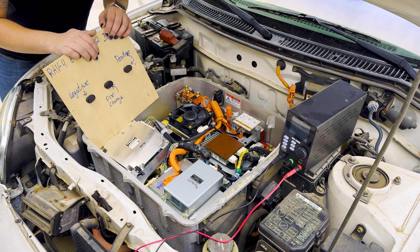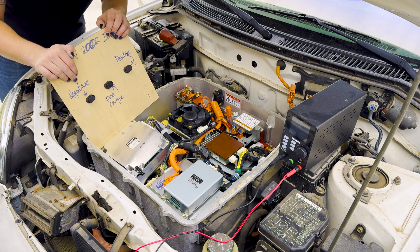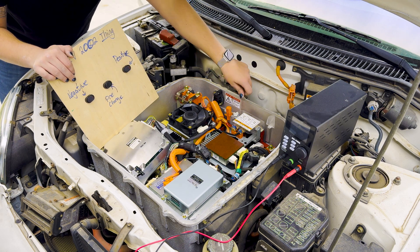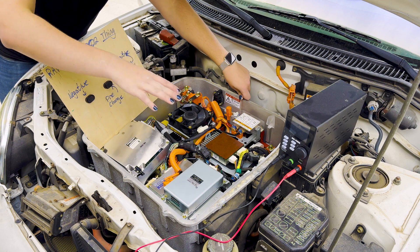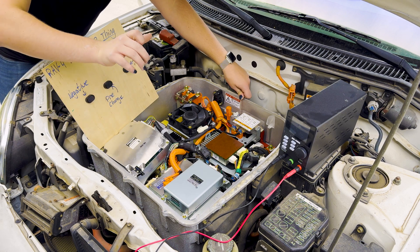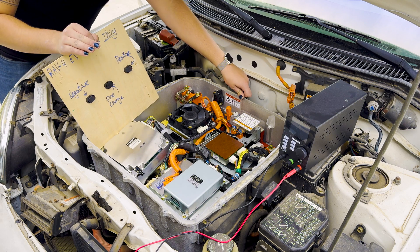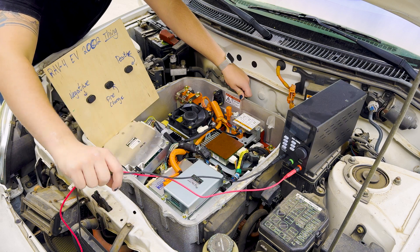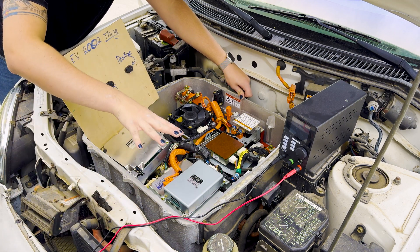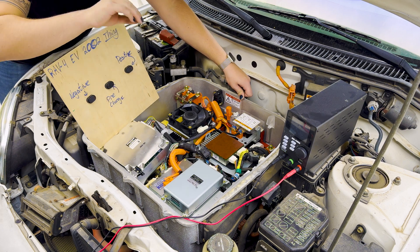Now that we know the real voltage of the battery pack and know how to override the safety systems, we're going to do something never recommended for any car — we're just going to try to jumpstart the traction battery. The battery pack is sitting around 27 volts right now, and I'm going to pump it with voltage, slowly raising it until it's around 200 volts, to see if we can get it to take a charge from its real charger. I'm hooking up my DC power supply — it goes up to 200 volts and only provides one amp, so it's nice and slow. It's probably going to take a day or two.